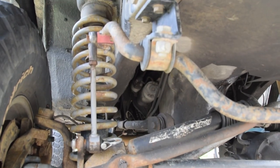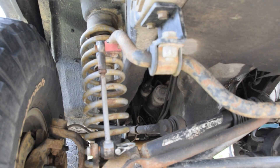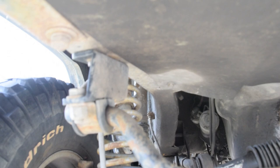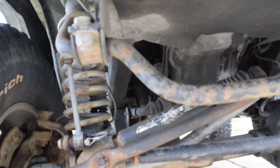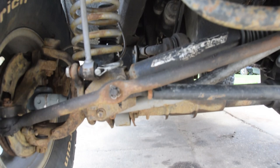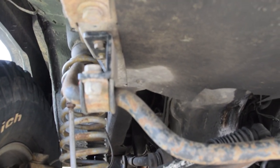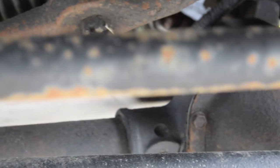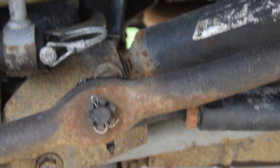If you come on under, you'll see we got ourselves a solid axle and a frame rail per se. I know it's not a real frame rail, but for the unibody Jeeps, this is the closest thing we got to a frame rail — that little do-hicker right there. What we're going to do is take a measuring tape and go from the axle tube to the frame rail and measure. You want to make sure that you get a flat part. There's a flat part and then there's raised parts on the axle tube. You don't want any of the raised parts — you want the flat part. There should be a little section over here that we can measure.